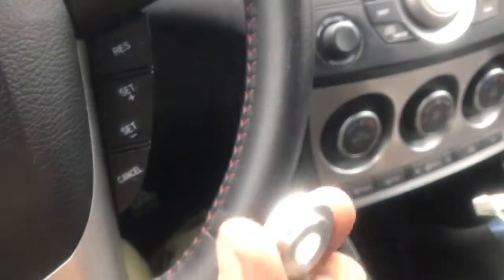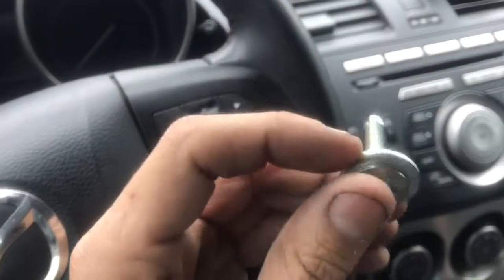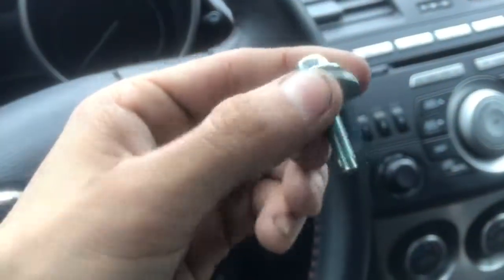And with the JBR bushings, you'll get the bigger one, and you'll put them at the bottom. When you're putting your shifter bushings in, I recommend putting these 2 in the back first, because if you try and put all 4 in, these are going to either slide out, or these at the bottom are going to slide out, and it's just a pain. So pretty much do those 2 first, and right when you have it secured, you're going to get your washer, and you're going to get this nut, put it like that. One side's going to be totally flat, and another side's going to be a little rounded off, so the total flat part goes at the bottom.